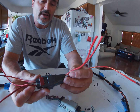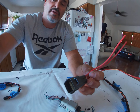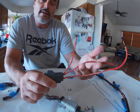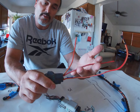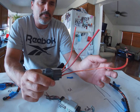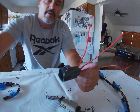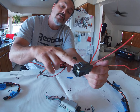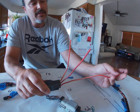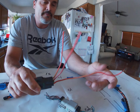We're going to have 12 volts going to things in the engine bay. This will be the PCM side and this is the engine bay side - one of these will go to my injectors from the PCM, and then to the coil packs from the PCM. I have the bigger wire here because when I splice off, we'll splice off to the normal size harness wire.